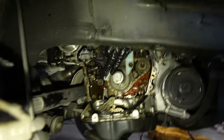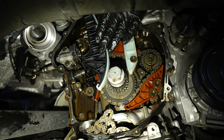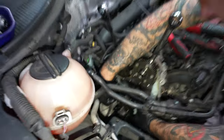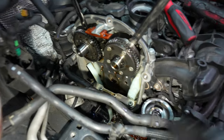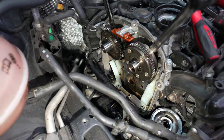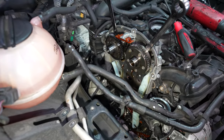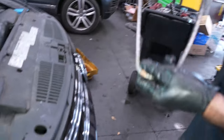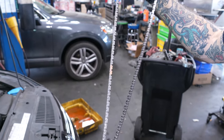You don't want to install the rear rail yet — put the rear rail up, then take the bolt to the rear rail right here. The rear rail rests right like that. Why do you just sit it there instead of installing it? So you can slide the chain on it. Exhaust cam, intake cam, crank shaft.